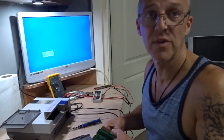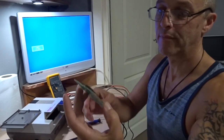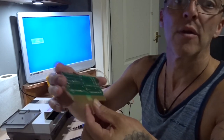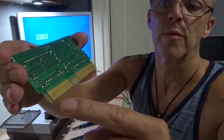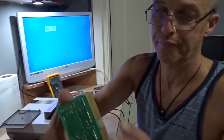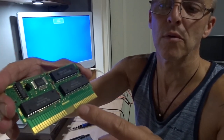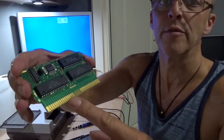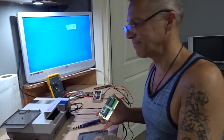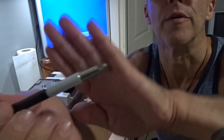If you've been wondering what's inside them, a couple of ROM chips. No problem with the chips. So the main cause of this flashing problem, I don't know if you can see, see how dirty they are? And this side as well. You can see it there. That's the cause of the flashing red light. It means it can't read the cartridge. All it is, is the pins.